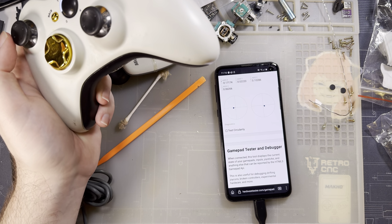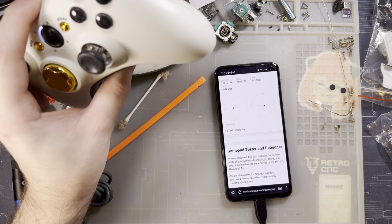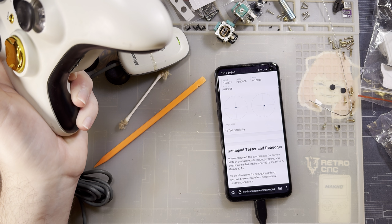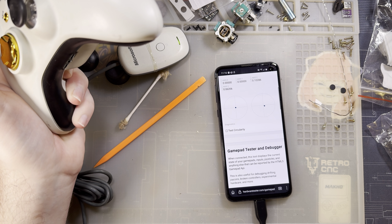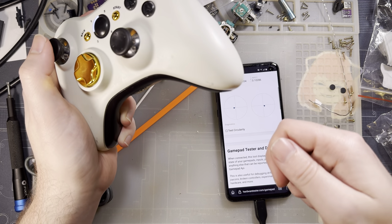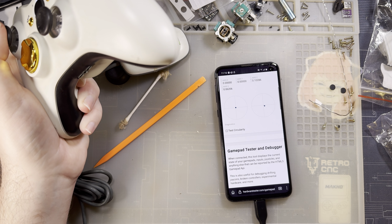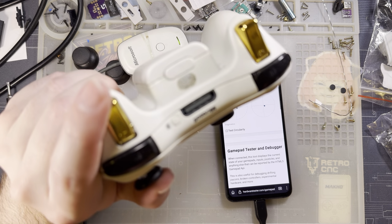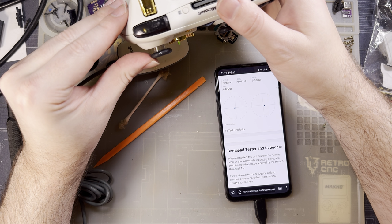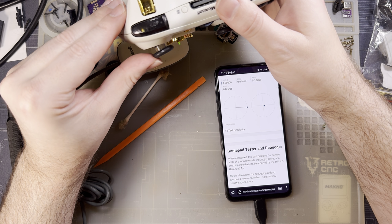The problem with those aftermarket center-your-joystick potentiometer kits is you lose range of motion. If I tell my stick that this is centered just by installing one of those solder-in kits with the potentiometers, you tweak it until the stick is in the center, that's fine, but you lose range of motion. You see how much I have to push the stick over to get it centered. I guess it's really not all that much, but it means that I have